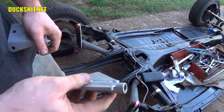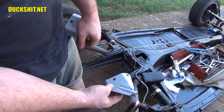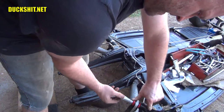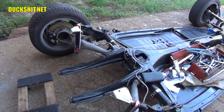These shock absorbers — I've got to put these bushings in. I'm going to be working on the top. The bottom bushing will have to be different because I discovered that the Porsche 944 bolts that go on the bottom are actually a different size. I've only got one of the bolts, and I'm going to have to drill the bushing out probably about a millimeter or so to make it a little bit bigger. Not too big of a deal. You just push these suckers right in — get them in there and try to get them as even as you can on either side. Next, we've got to put our wings on, and judging by that 45-degree angle this one should be on the right.